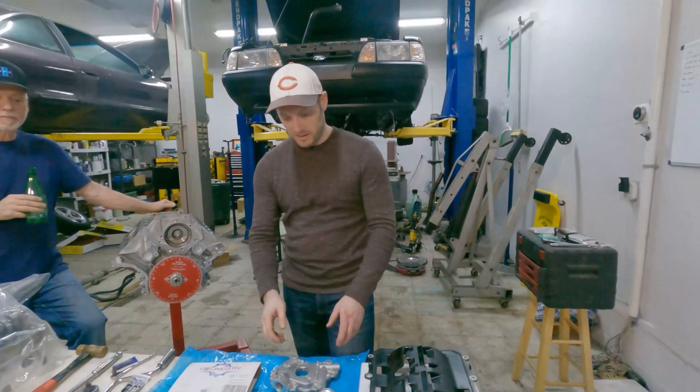These are actually pretty hard to assemble because they've got this spring on here, and the spring causes it to default to a fully advanced position. This little thing in here is a locker — it'll drop down, and it's locked now. I can't move it. So when there's no oil pressure, it locks into the fully advanced position. The spring does that. So if you had a loss of oil pressure or you're just starting the engine, it'll keep the phaser from knocking around inside there. This locking piece is really important and really easy to lose. The revisions include a new version of this — it really helps lock it at idle to keep it from rattling.